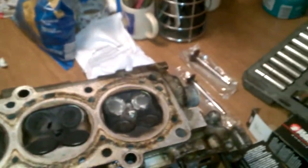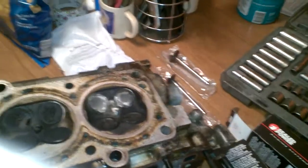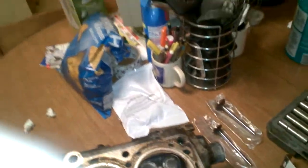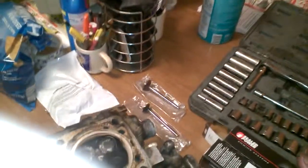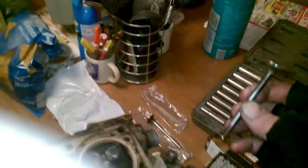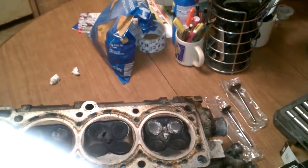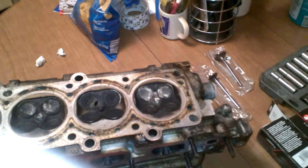These valves were not easy for me to source — I had to get them from Rock Auto and Amazon. Melling was the supplier that both AutoZone and O'Reilly showed; in my area, they were priced at about $15.99 per valve. These cost me about $12 per valve plus shipping. There are other engine manufacturers such as Engine Tech. When you look for valves, look for a reputable dealer and look for flat faces — flat faces will give you a little bit of extra compression. I do recommend running premium fuel if you do the flat valves in your Saturn, as they are known to knock on 87 octane with stock valves, which will get worse if you bump compression up.